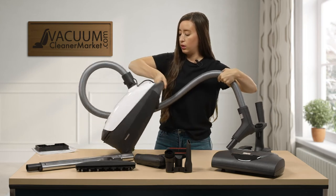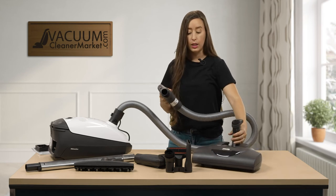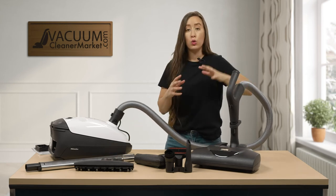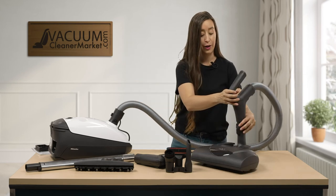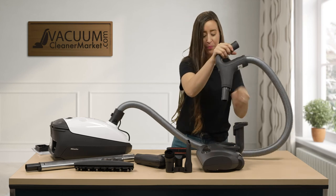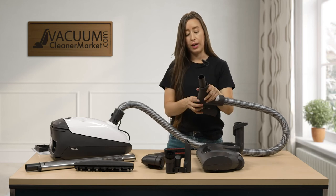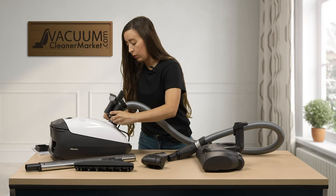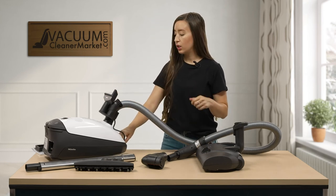The nice thing about these Mieles is that you can use your attachments — your cleaning attachments, your flooring attachment, your carpeting power head — directly with your handle, which is a very nice feature. If you want to clean your carpeted stairs, a high-reach carpeted area, or use it in your car, this is how to do it without the added length of the wand. To release your attachment, you step down and pull up. Then there's this Vario clip — there's a little indent on the hose that matches up with a protrusion, and you just slide it on and it clicks. This is how your tools are stored on the body of your canister within easy reach, gliding along with you wherever you go.